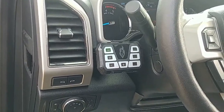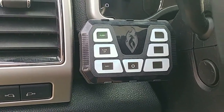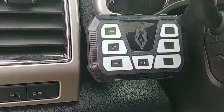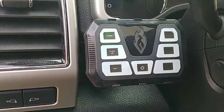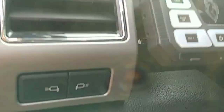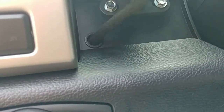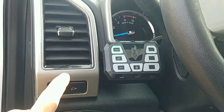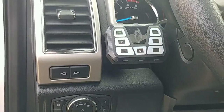Back inside the cab, here's what we did. We've got our Mini 6 switch panel, set up for the customer just like he wanted it. He's got three upgrades coming later on the right-hand side — a fuel tank on AUX-1, plow up to turn on his plow, and above it, flash. Keeping it fairly simple, we mounted it right there using some nice long screws to grab both layers of plastic. We drill a hole right there — that's a fairly easy piece of plastic to replace — and those wires come out right behind here. Remove this panel and you can get at those wires real easily.